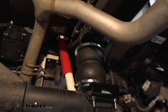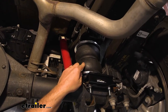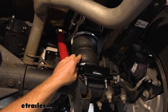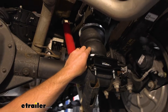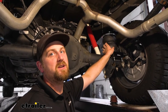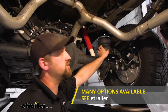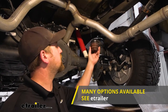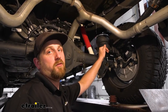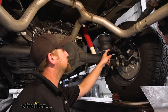That's where the airbags come into play. The cool thing with airbags is that they're adjustable — you can run these between 5 and 100 PSI. Most people find the sweet spot somewhere in the middle or on the lower end, but you have the option to run them all the way up to 100. Compared to some other suspension enhancements — like Timbrens or Sumo Springs, for example — those will replace your jounce bumper and provide continuous support, which is great. They work and they're maintenance-free, but you can't really fine-tune them. That's where the airbags stand apart.